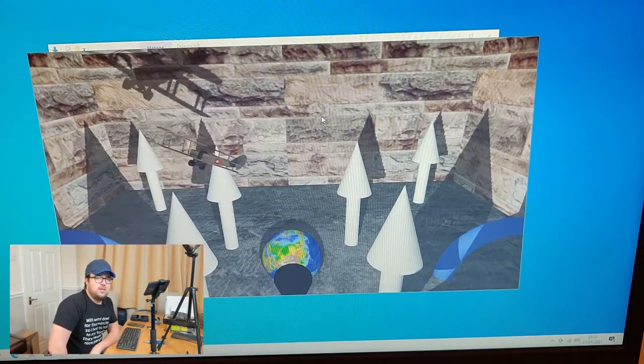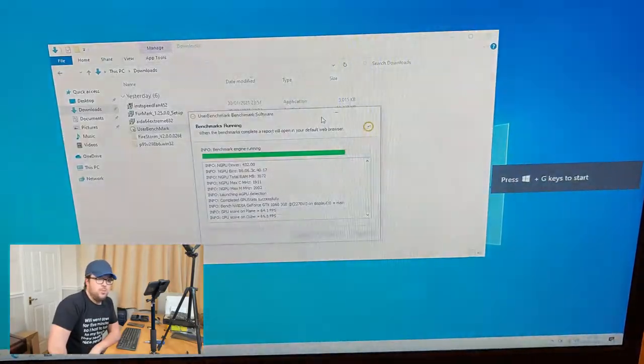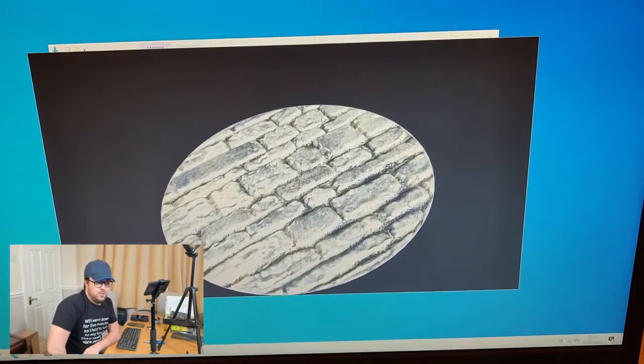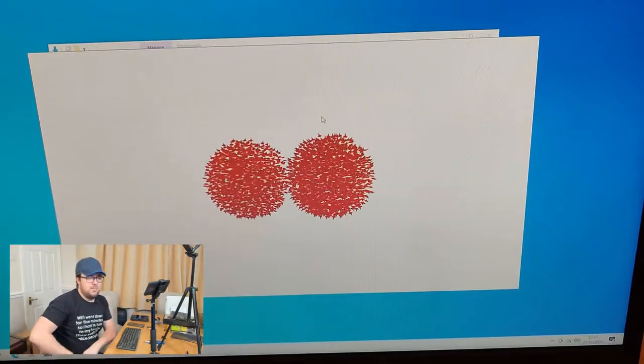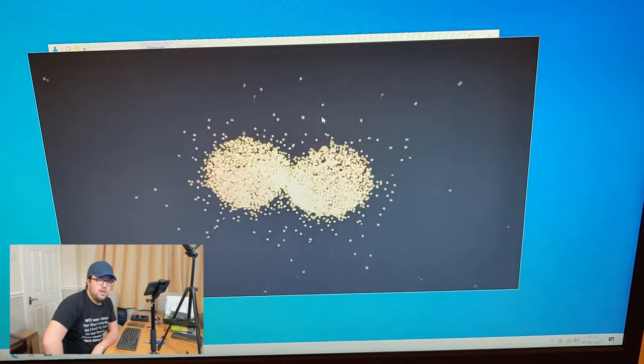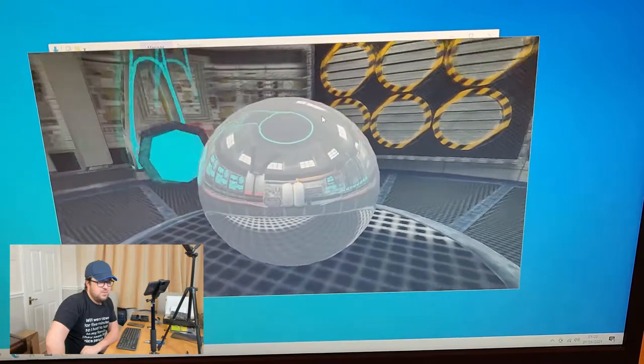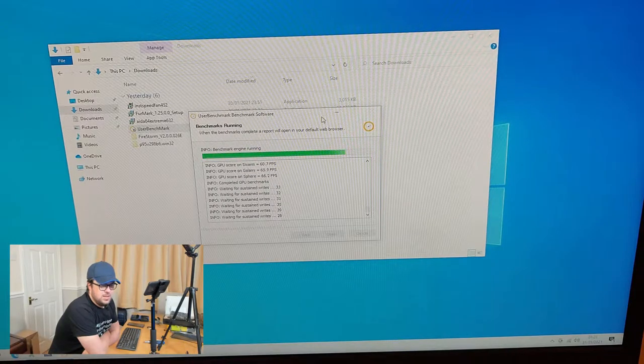You know, there's nothing overclocked. The GPU is running at standard. Clearly, if we wanted to, we could actually up the clocks of both the CPU and the graphics card, because we've got that little gap in temperatures, presumably because the CPU core is excellent and the graphics card core is working well and as expected. But as a stock measure, we'll be able to see how this goes. There shouldn't be any particular bottlenecks in this machine. I'm running the graphics card in a PCI Express slot that shouldn't throttle the bandwidth of the card. So what I'm expecting is roughly the 50th percentile, somewhere in the middle, on pretty much everything.